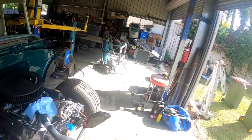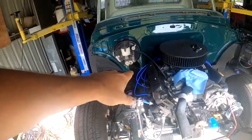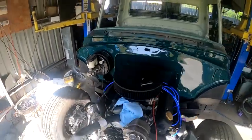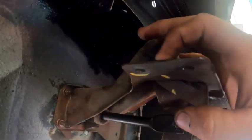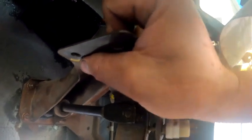What I'm going to do is make the stabilizer bracket for the pedal box — that's my first job. And then I'm going to look at getting the steering column moving and mounted, and making the sealing plate for the firewall. I've got that pedal box tightened up. I've got to make a little bracket to go from the top of the pedal box to where the original pedal box used to bolt up — a straightforward bracket that'll stabilize it and stop it moving around.